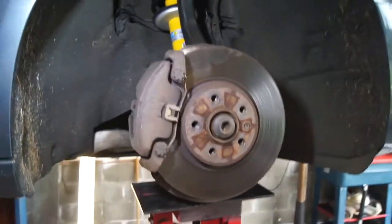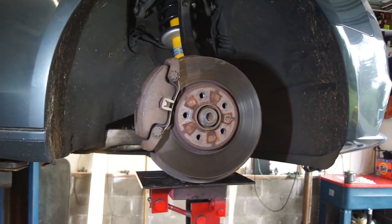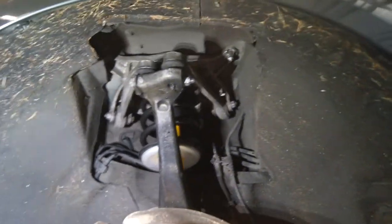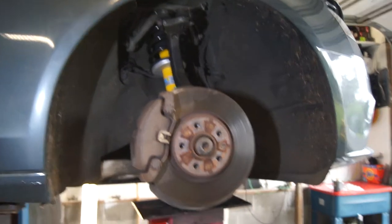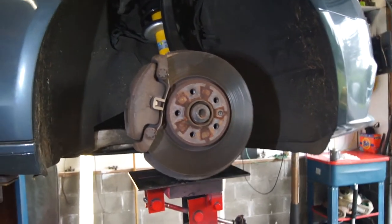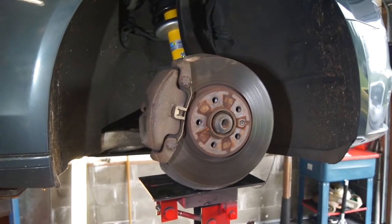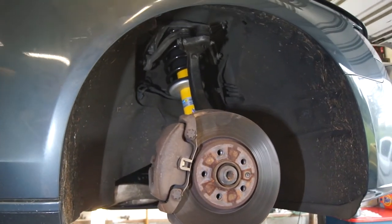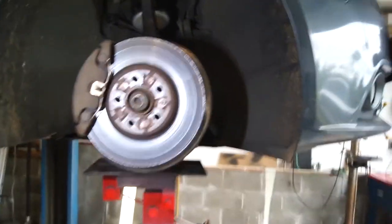So I wanted to show you this: when the suspension is all relaxed and you tighten everything up, you have a tendency to bust seals on these little rubber deals here — or they're always under tension and eventually they'll bust. So what I like to do is jack it up to where I think it's going to be about normal ride height, and then snug up all the bolts. Then its neutral position is there, and when you lift it up off a lift or something, it has a little bit of tension on it. Do that carefully if you're doing it on a lift because it has a tendency to jack up the whole car.